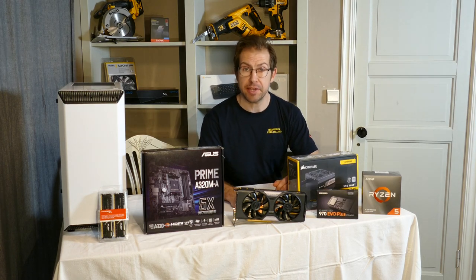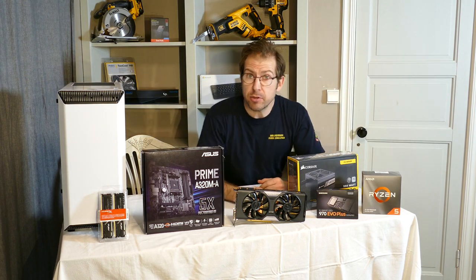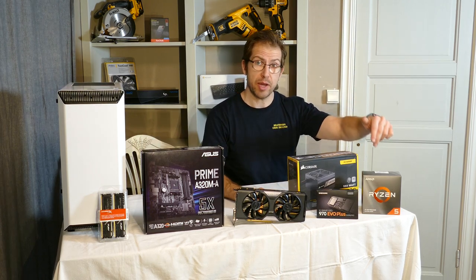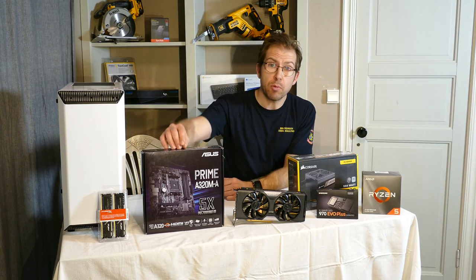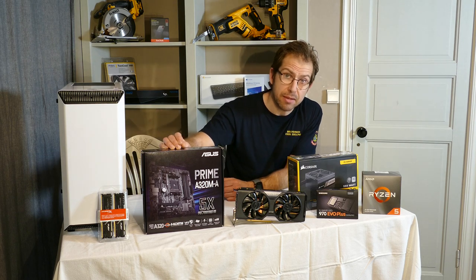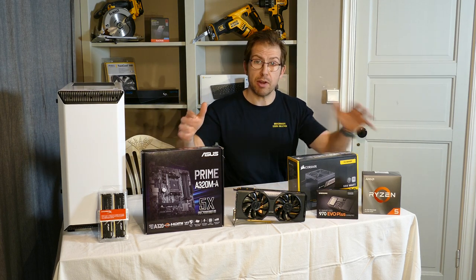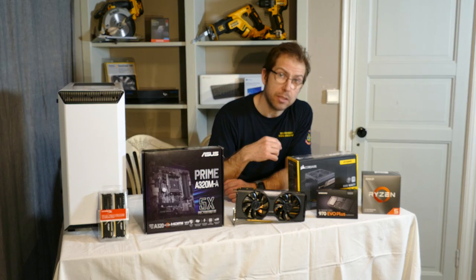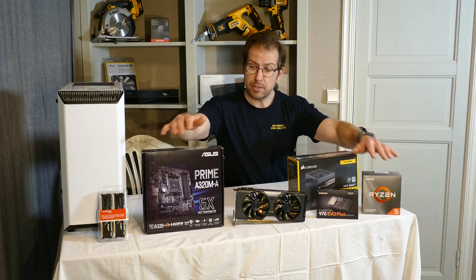This is a super exciting day for me because I'm going to build my new computer. I've been researching, of course, I'm watching YouTube, and I think I'm going to manage to pair up an AMD Ryzen 5 3600 CPU with an older model motherboard, the ASUS Prime A320MA. According to the ASUS homepage, this is going to fire right up if the motherboard BIOS is newer than 4801, and according to the store that sold it to me, that's the case. So I hope this is going to fire right up.